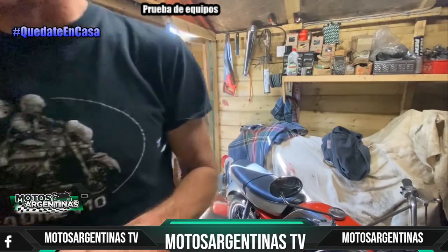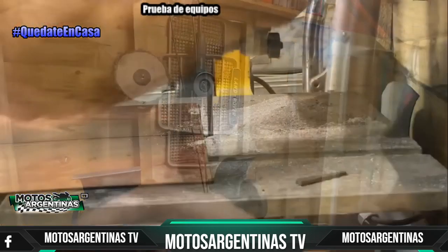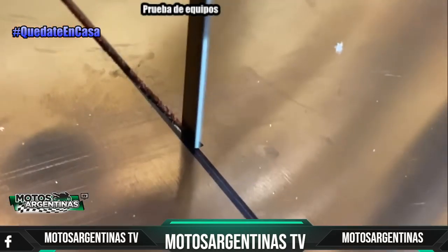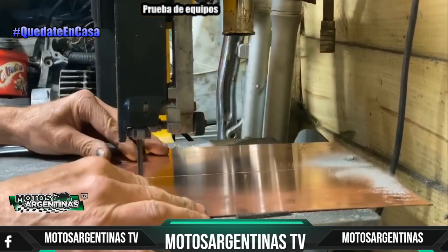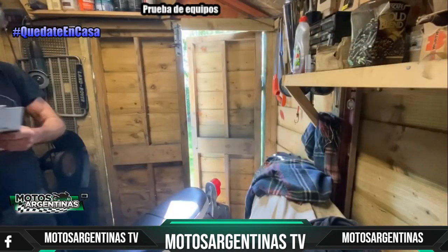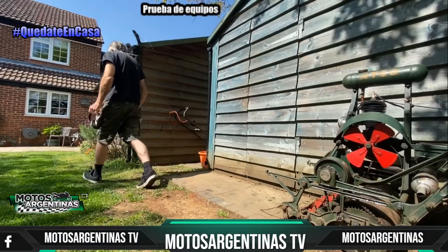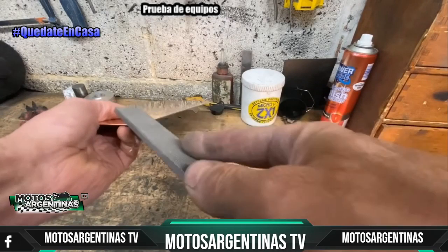In the shed, I'm going to use my bandsaw to cut the copper sheet in half. I wear ear defenders for this job because it can get very noisy. The trick is to go quite slow and not push too hard to keep a straight line. Back in the garage, I use a file to take off all the burrs from the sawing process.